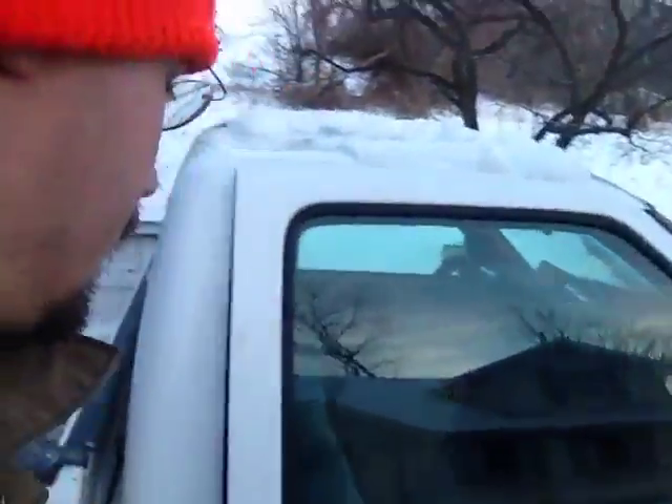Hey folks, it's been an hour, maybe two, since the last chunk of video I shot, but I got the bed off the truck — or rather, unbolted. You're probably looking at it and saying 'Ben, it's still on the truck,' but I assure you it's no longer connected to the frame. To prove it, I've got the bolts right here. All that was holding the bed on were eight 15mm bolts. I got all those out, pulled the gas cap filler neck off, and disconnected the wire harness for the rear lights.